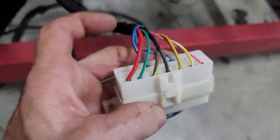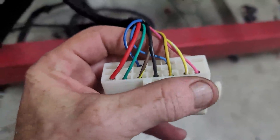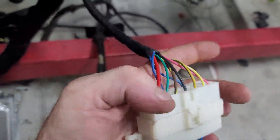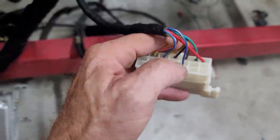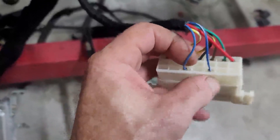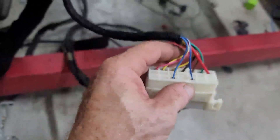Over here is your client plug — you've got seven wires to connect to your vehicle: fuel, ignition, start, rev counter, temperature gauge, oil light, and charge light. The two blue ones at the bottom — blue and blue-with-white — are AC and ACMG. I don't particularly advise using those; there are other ways to handle idle-up when your air conditioning compressor kicks on and off.